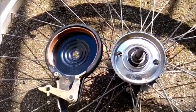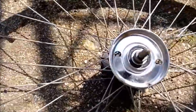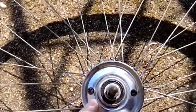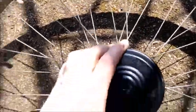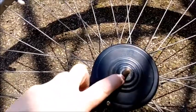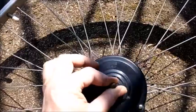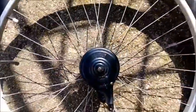I'm going to show you quickly the fitting so you can see how it's put together. Once you've put the drum on, it screws on clockwise and comes off counterclockwise. Simply fit the drum on and then there's a nut that goes here to hold this to the main rim on your axle — that's usually a 17 millimeter nut. I'll just pop back in the workshop.